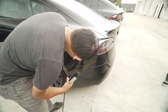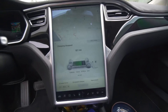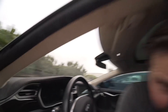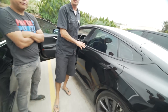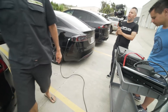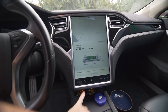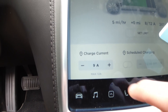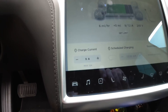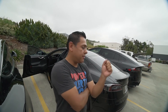Let's plug it in. It's green — oh, charging stopped. We broke it. Maybe the amps were too high. His amps were too high so I turned it down to the minimum, which is five amps, and it's charging at five amps. It is confirmed charging. On the Model 3 it will do 10 amps, but on the Model S it will only do nine amps. Still though — that's six miles per hour.